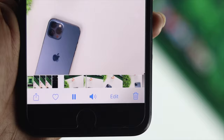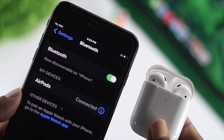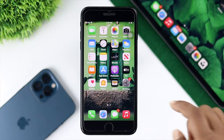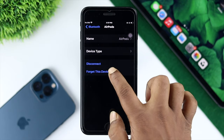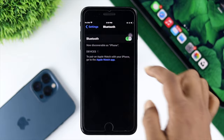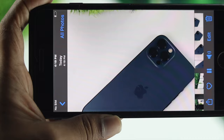The next thing to check is your Bluetooth section. If your iPhone 7 or 7 Plus is connected wirelessly to any Bluetooth device, your iPhone will start picking up sound from that wireless microphone instead. Go to Settings, tap Bluetooth, and make sure everything is disconnected. If you see a connected device, tap the info icon, tap 'Forget This Device', then 'Forget Device'. After that, your iPhone will start picking sound from its own microphone. Check whether your problem is solved.